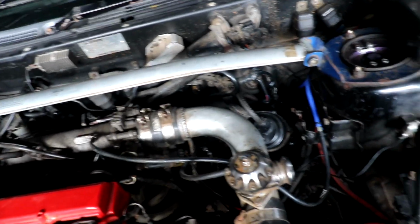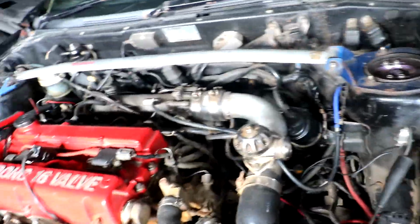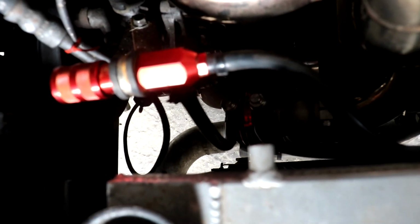There's still a couple of things I would like to clean up on it, because the air intake temp sensor is actually on the intake pipe of the turbo. It should have been before the throttle body. Also we'd like to clean up some of the piping, and you see that the manual boost controller that's on it is also plumbed incorrectly. So I have those couple of things to change before doing anything else. Also the screamer pipe has to be installed for the wastegate.